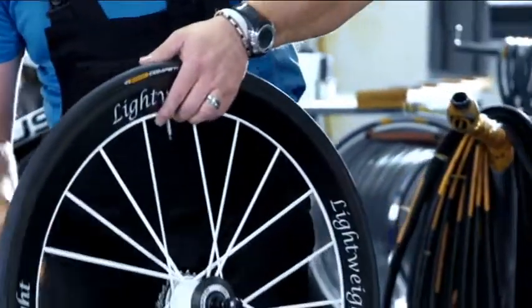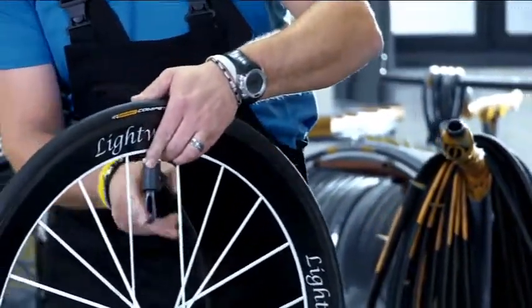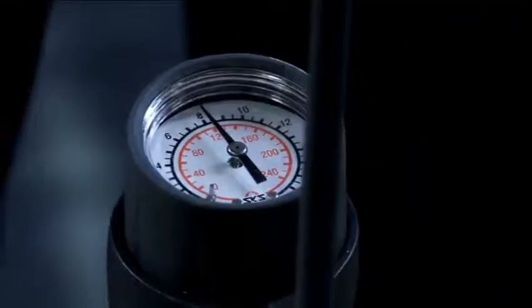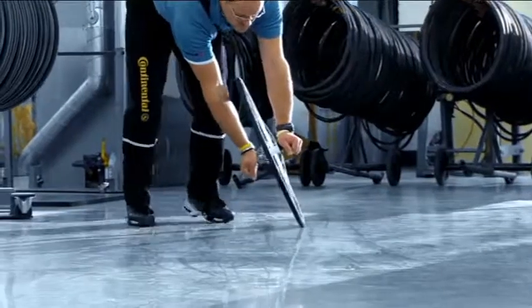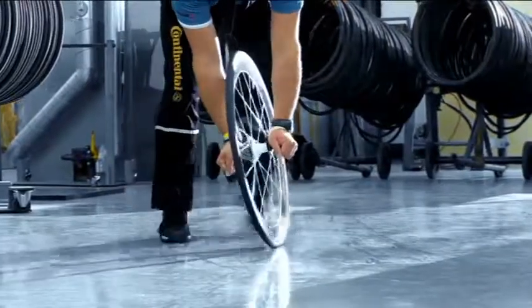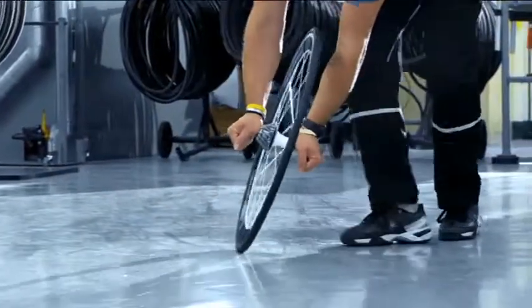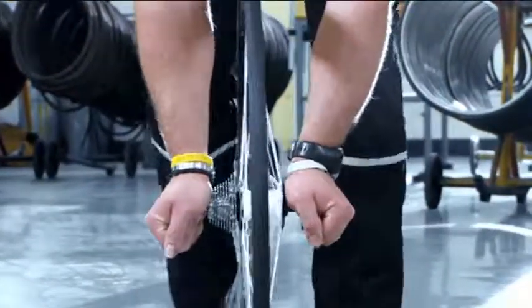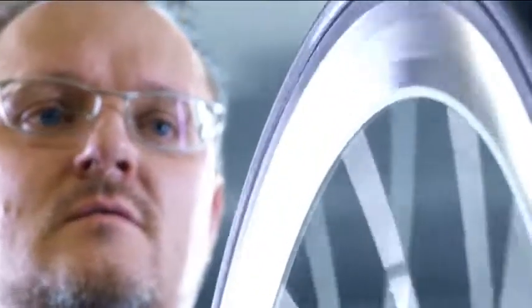If the tire has no lateral runout, remove the wheel from the stand and inflate the tire fully. Apply load to the wheel using the axle journal and the quick clamp and roll it along the floor for several meters. The wheel should be vertical as well as tilted to the side for several rotations. Then check that it indeed runs true and has no radial runout.